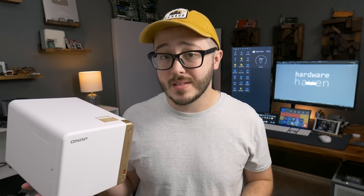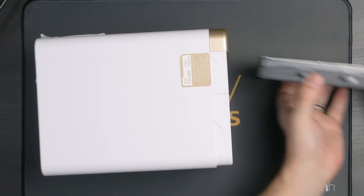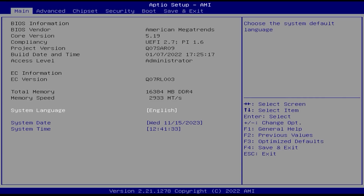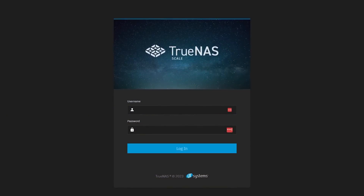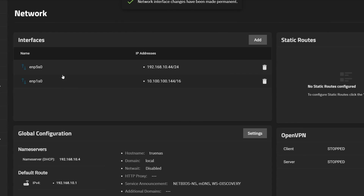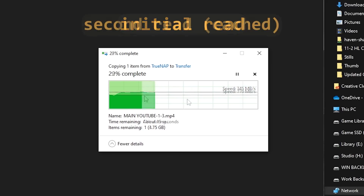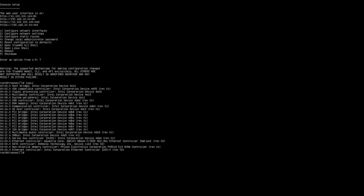But do you even need to use their software? After all, this is basically just a little Intel-based PC — so could you install something like TrueNAS on it? I took out all the drives and put in a single NVMe as a boot drive, plus a flash drive with the TrueNAS install image. After spamming a variety of F keys and Delete, I got into the BIOS and changed the boot order to boot into the installer. Installing and setting up TrueNAS went off without a hitch, and within a few minutes it was up and running. I reinserted the drives, set up a pool with two mirrored VDEVs for better read performance, set up the 10GB interface without any issues, and had a TrueNAS server up and running. The fan and status lights all worked normally, and performance was pretty good for spinning disks.